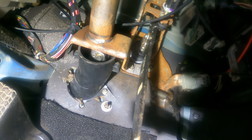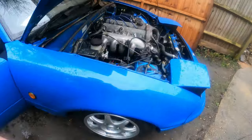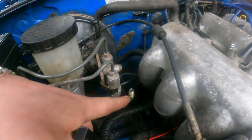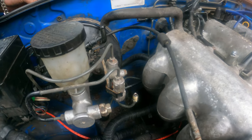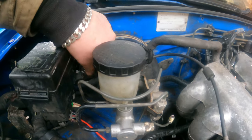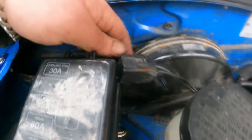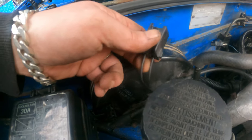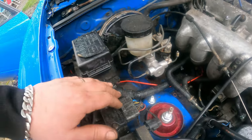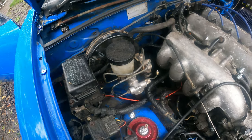The pedal is attached and everything is set up again. I've got the master cylinder back in, and this last fitting is just being a bit of a pain. After I get this one back in, I can put the reservoir in here as well. There's also a plug mismatch — it's not the same plug — so I'll cut it and use the plug from the old one with a soldering iron. Then we can bleed the brakes and see whether we actually have brakes or not.